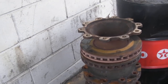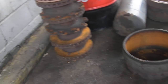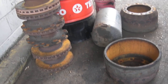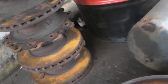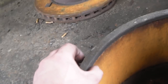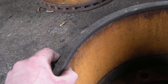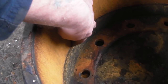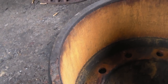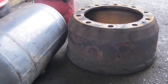At the back of the workshop I've got a stack of brake discs — the top one you saw a video on, how cracked it was. I also did a pair of drums here: one was okay and the other was worn. Always do them in pairs — always do brake shoes in pairs, especially on the front or rear axle. This brake drum was just within tolerance, but it was slightly convex. The other one was heat cracked anyway, so yeah, always do them in pairs.